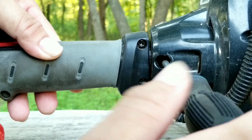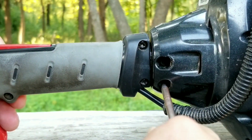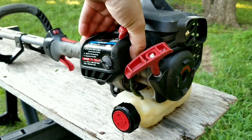Also try not to over-tighten the screw otherwise you'll damage the threads. After we install the set screw we can now tighten the clamp screw. We shouldn't have any problems after doing this, but let's start the engine and make sure it still runs.